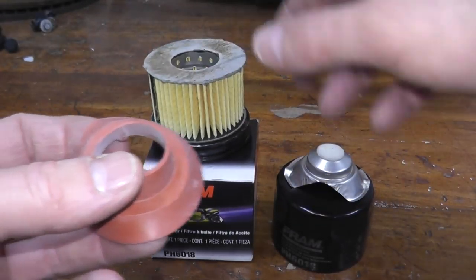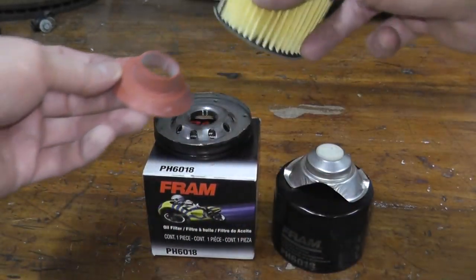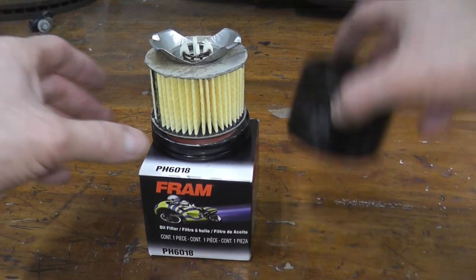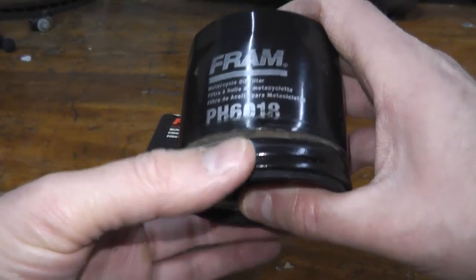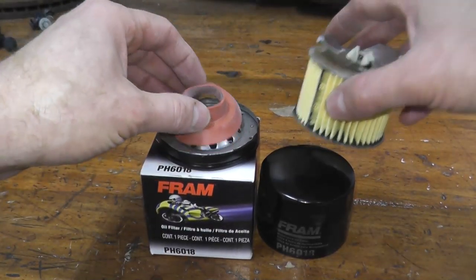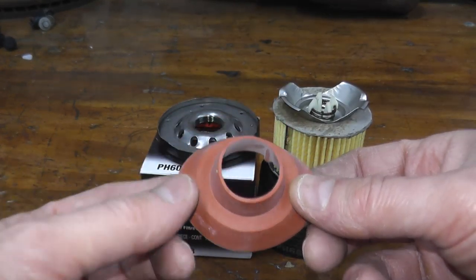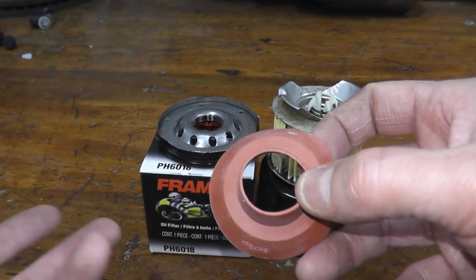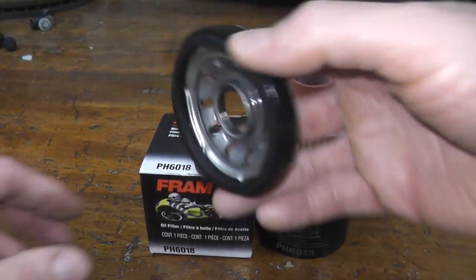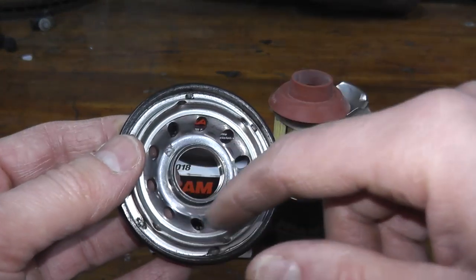This is one reason why you pay a little bit more — this is actually the most expensive filter out of all four, though only by about a dollar. This is an anti-drain back valve. The whole point of this valve is that when you shut off the engine, instead of having all the fluid drain out of the filter, this little valve retains the oil inside the filter so the next time you start your bike you don't have a dry start. On some lower-cost filters the material used is nitrile rubber; this one is silicone. Silicone is found on higher-end filters because it can withstand lower and higher temperatures better than nitrile rubber. So it does run a silicone anti-drain back valve. And of course you have your gasket on the end — just put a little clean oil on it when you change the oil — and an all-steel base plate.